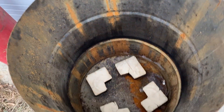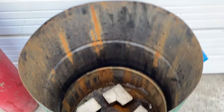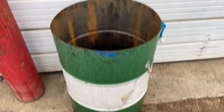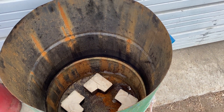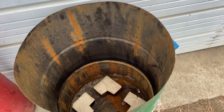This is the drum I'll be using. I cut some blocks of wood for the bottom to keep the engine block hoisted up. I'm going to put the positive to the barrel, negative to the block, fill it up full of water. I think I also need to get some solution — I've seen somebody used Arm & Hammer washing soda, not baking soda. So I'm going to pick some of that up and see how it does.